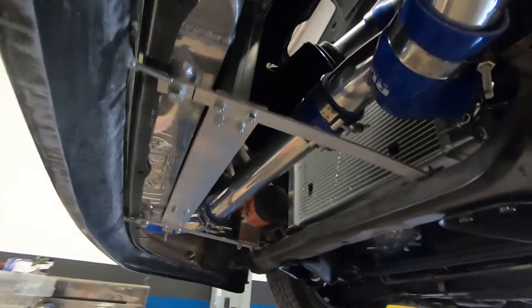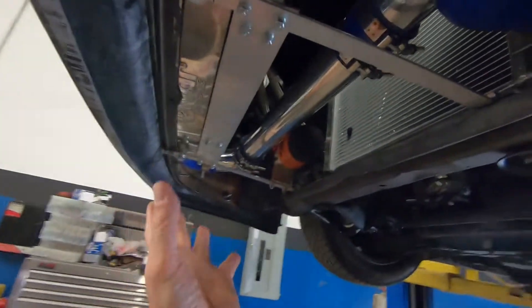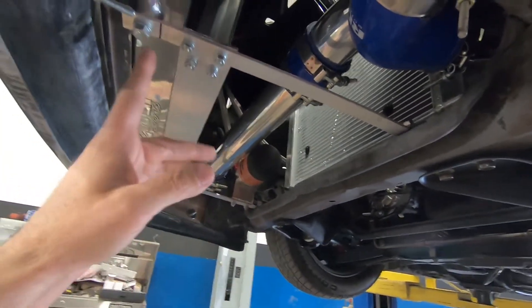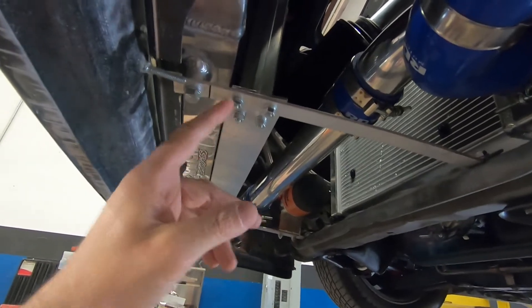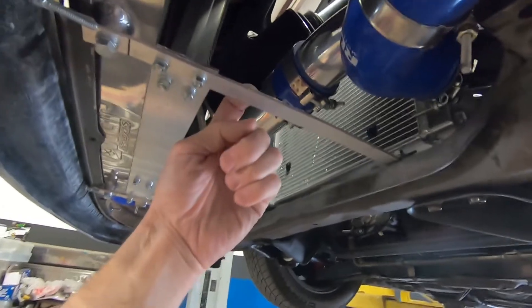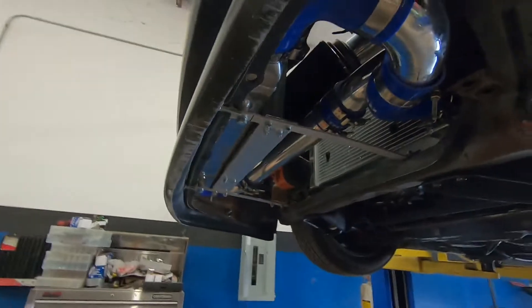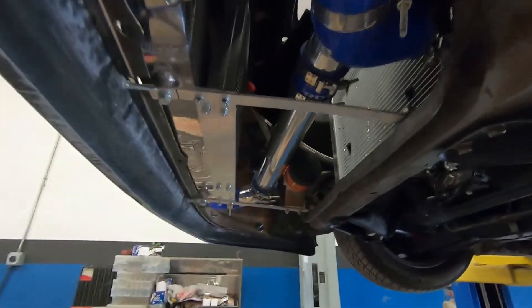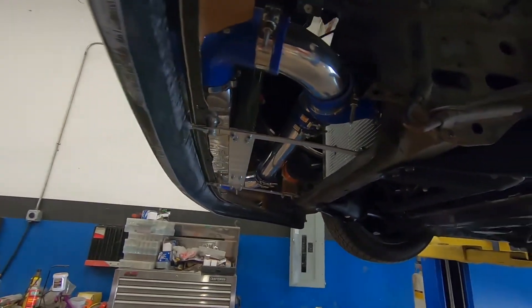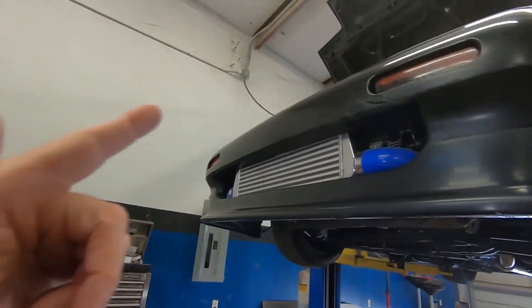It's best to work with cardboard to make a template, because I need to know exactly where the nuts and everything are placed. Once I make my cuts on the aluminum and put it up and bolt it on, it needs to have space to clear the aluminum sheeting. That way I can take rib nuts, mount them to these beams here, and allow me to bolt it in as a bolt-on application. Let me do a couple of measurements and we'll come up with the game plan.